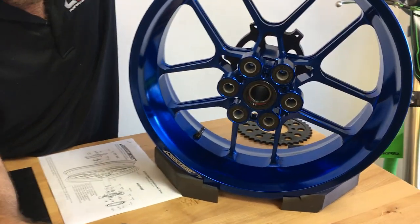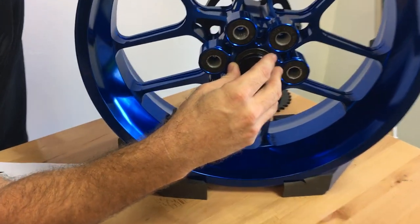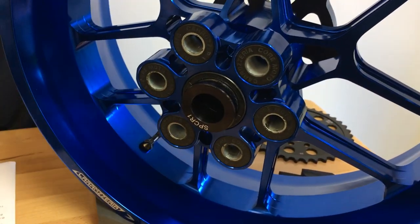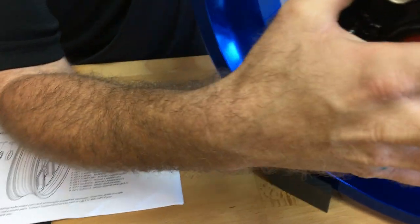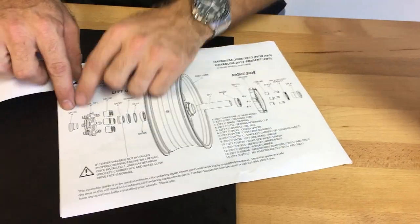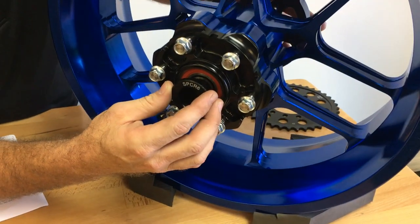On the drive side, you have a spacer that goes in between the wheel and the sprocket carrier, held captive by the oil seal — that'll be detailed in the drawings. This is a really crucial spacer. If it's not installed, you're going to have bearing failure on at least the sprocket carrier and likely inside the wheel. So we slide these in, and per the sheet, spacer six goes into the sprocket carrier — slide that in place and then flip the wheel around.